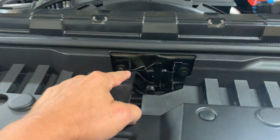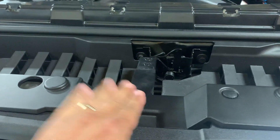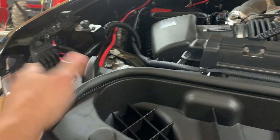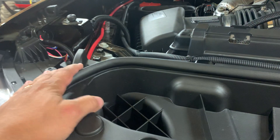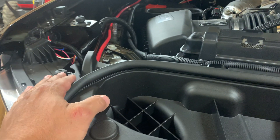You will have to take this off too — just two bolts, real easy. Take that off, take the headlights off. There's a clip on those — a red clip — just pull it all the way back, and you'll see the red clips. Use a screwdriver, pull it all the way to the back and the plugs should come off. If the plug is giving you problems, you don't have it all the way back enough.